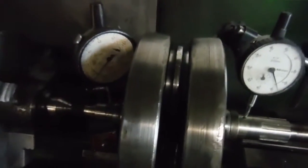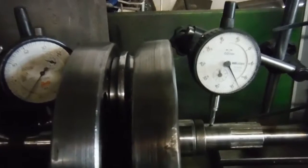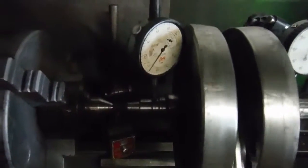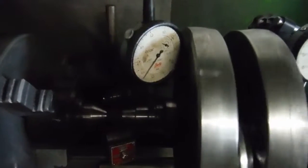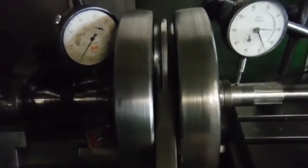This is a fairly typical example of what you can pull out of a running Indian Enfield Bullet engine. This crank has got a lot of run out right at the main bearings where you don't want it. I'll give it a spin now — we've got no run out on the timing side main shaft, so that's running true. God knows who's been hitting the flywheels with what to align them.